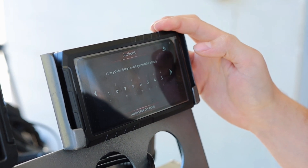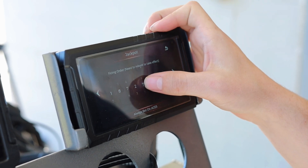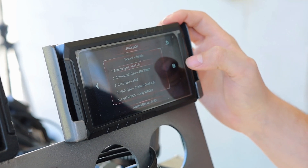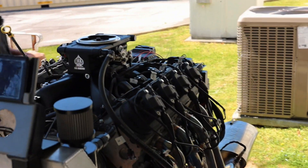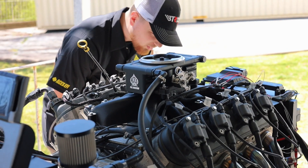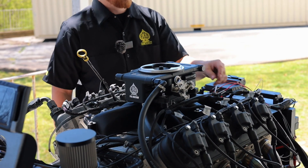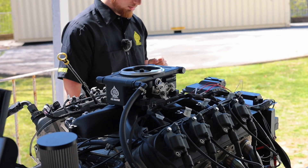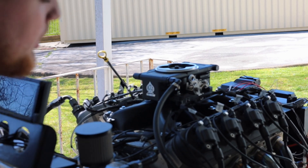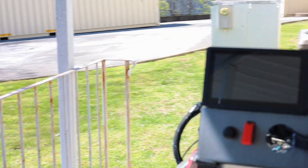On the HD handheld you've got a little scroll index — 750 sounds good. Yes, we're going to save it. Now let me go verify all my connections are hooked up and we'll start it. Wideband, knock sensor, cam and crank, ignition, oil pressure, throttle, coolant temp — yes, okay, everything's hooked up.